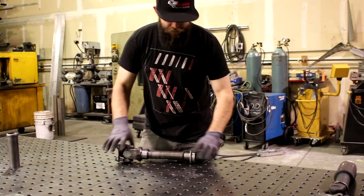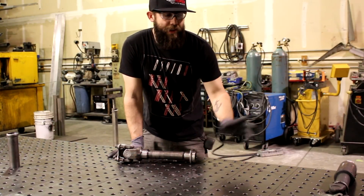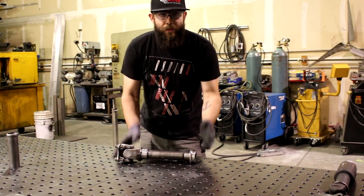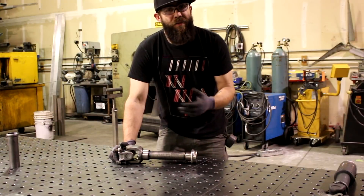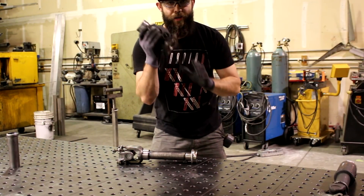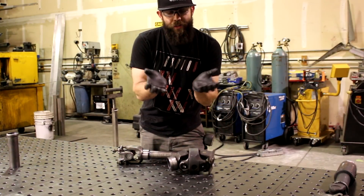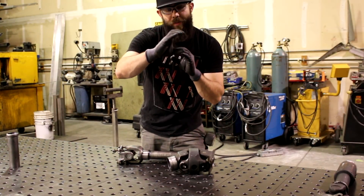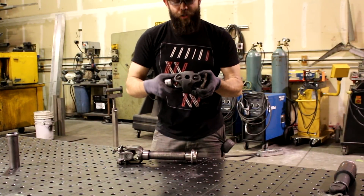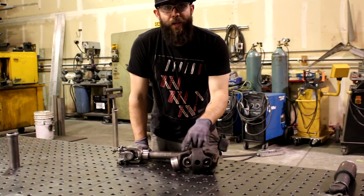The reason you might want to do this is for $275, if you already have an older driveshaft that you're going to use the CV from, it's a lot cheaper than spending maybe 400 bucks for somebody else to build you a driveline — plus you get to build it yourself. Also, one of the reasons I'm running the CV on the transfer case side is because the mini truck axle differential is centered but the Samurai transfer case is offset, so this helps minimize vibration. Anybody running a Samurai transfer case to a mini truck axle — this is the way to go.